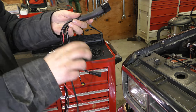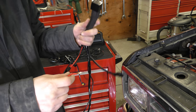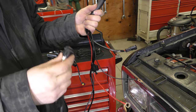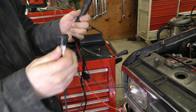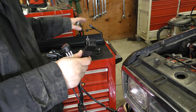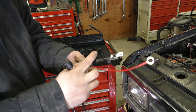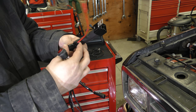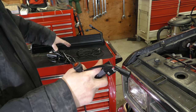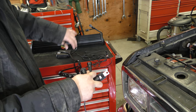Starting off with the wiring, we'll start right at the beginning — the way they have it set up, connecting it to the battery, which we're just going to connect to where the battery terminates. From there it goes to a relay, and from that relay we've got a switch here that turns the relay on. I'm not entirely sure yet if this actually turns the light on or not — I'm suspecting it just turns the relay on. The connection for the battery there has a fuse on it, in this case a whopping 30-amp fuse, which seems a bit excessive considering it should only be a 120-watt light. And of course the ground for the battery there. Then we have a connection here for this control box, and you shouldn't be able to mix these connections up — they only go one way and only connect to each other.